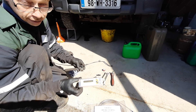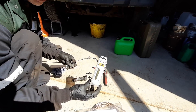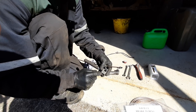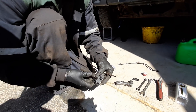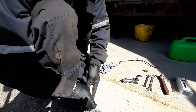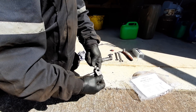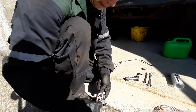We're using this Tech 13 316 handheld brake flaring tool. It's very simple to use — you can get it at the local motor factors and it gives great results. Start off by putting the stop into the actual flaring tool, leaving about 5 millimeters of space at the end. Close down the clamp bolts partway so you can slide the brake pipe into the tool and push it up against the stop. Close down the clamps and tighten the stop until it hits the shoulder, giving the correct length of exposed pipe. That's a 10 millimeter hexagon to tighten those.